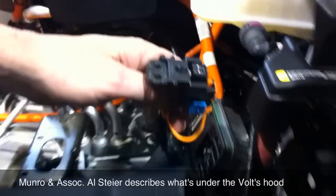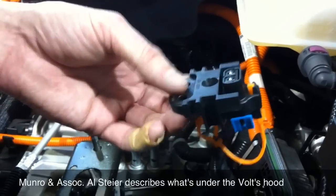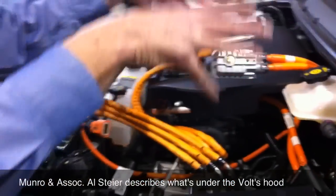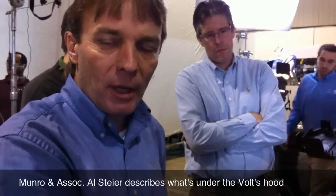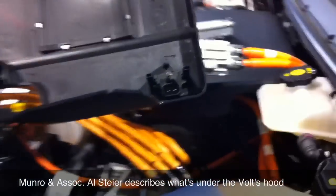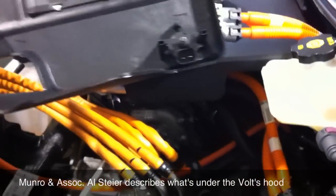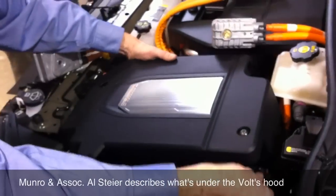Probably the interesting thing, though, was this right here on the back of the module. This is one of the circuit interlocks, so that when you disconnect it, it tells you if someone tampered with the whole thing, or it disables the whole power electronics. It actually interfaces to the cover we took off — the whole beauty cover set over it. So as soon as you pull that cover off, it disables the electronics at that point. I guess it's probably a safety measure in case the service or repair tech didn't pull the service disconnect plug. As soon as he pulls this, this connector interface is right here. And it's got the attachment for this cover as well, with one little grommet and another fastener — similar to this interface to this connector.